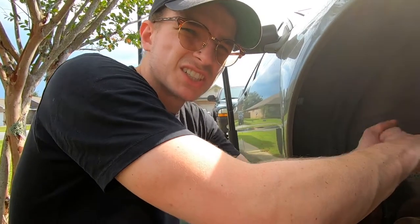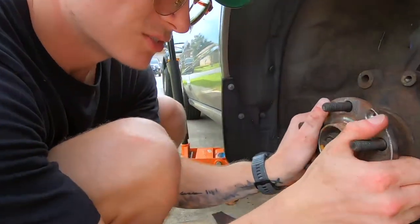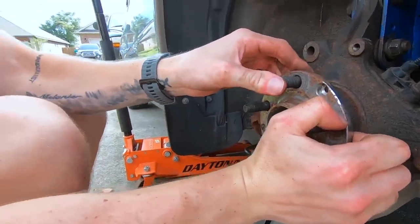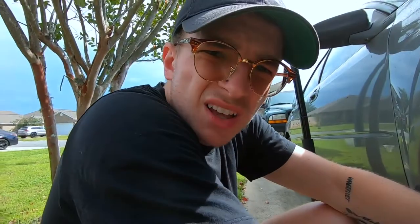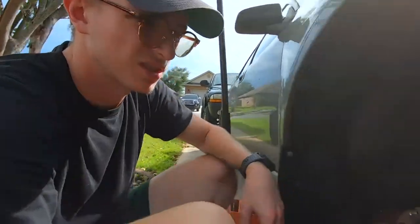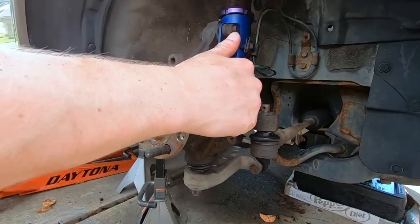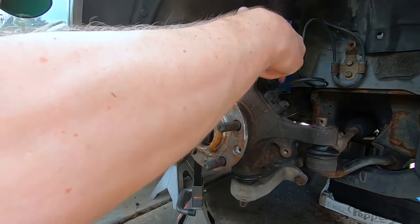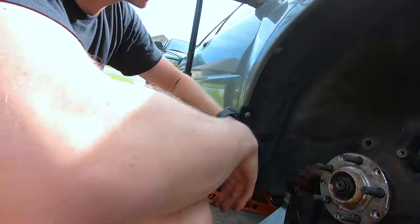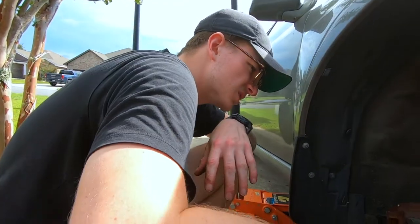We moved — and here's the old wobbly guy right here. So we got the caliper, rotor, and brake shield off. We got this bolt off, and we're going to drop this. We also have to take out the sensor, get the two coilover bolts off, get the bottom loose, then we should be able to take the hub out and get the nut off.